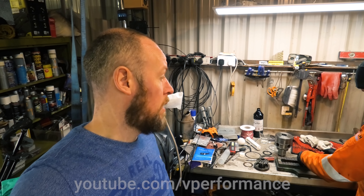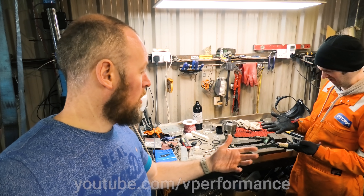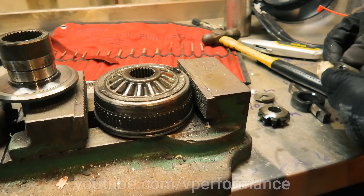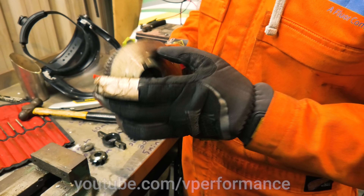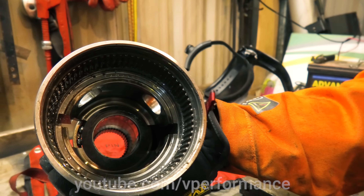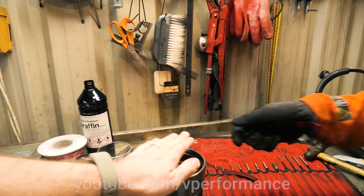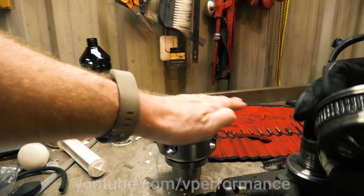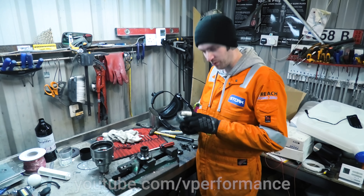The front drive shafts just don't spin, because all the gubbins Dave has removed is what sends power to them — it's not going to be there anymore. Later on we may have to remove the front drive shafts if we want more lock, because I think they foul the steering mechanism on extreme lock. But we'll cross that bridge when we come to it. We're doing this in phases, and we'll document the whole thing, because people don't document the whole rear wheel drive conversion process.